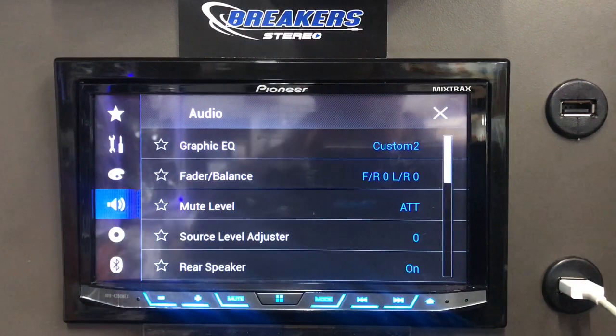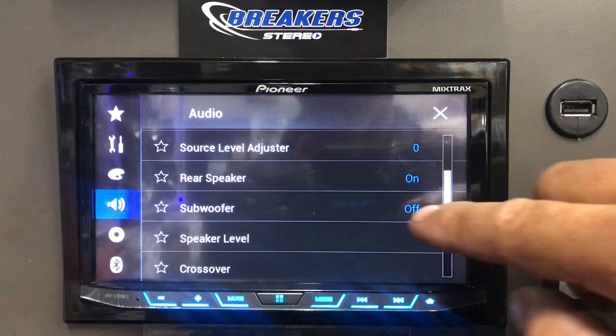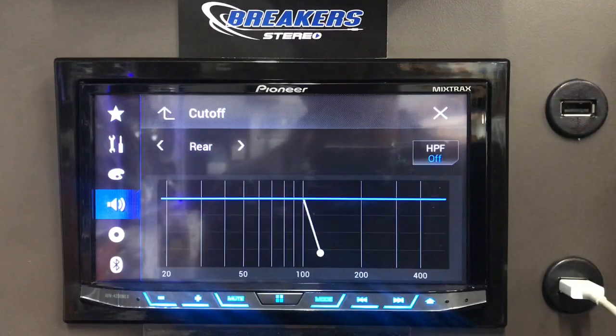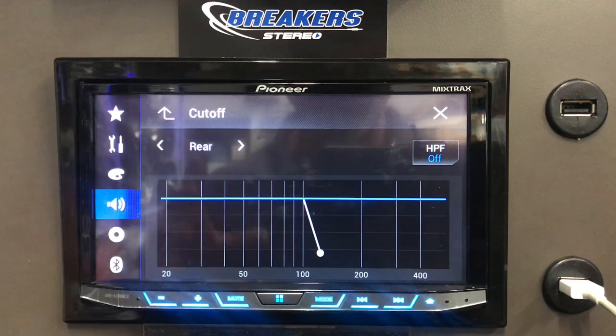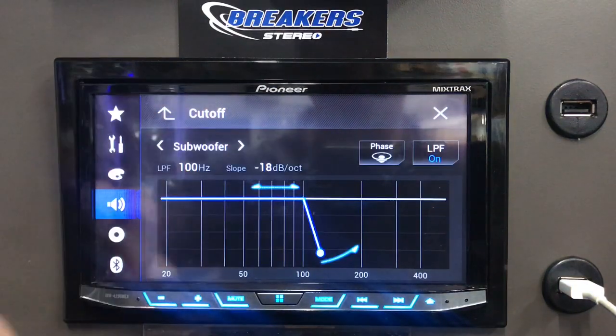Now on to sound. We talked about the equalizer. There's a subwoofer option — if you have a subwoofer you have to turn it on or off depending on whether you have one. Then there's the crossover. On this radio you can use the crossovers to hook up to your aftermarket amplifier, or if you don't have one, you can still crossover the speakers hooked to the radio's power. So if you wanted to add some bass but not buy a secondary amp, this will allow you to remove a lot of the bass through the crossover system.